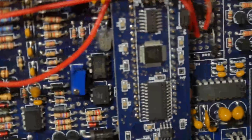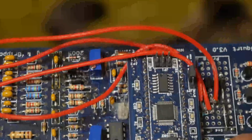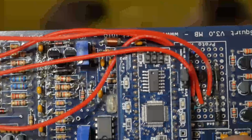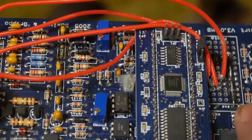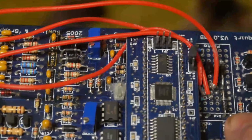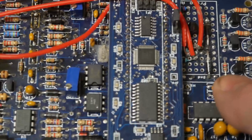All right, with the modifications complete, just one last thing. While we have a chance to view it, see those two blue boxes? Those are what you may hear me talking about later as we're trying to adjust the signal for the VR sensor. Those two are basically noise filters, and those screws in the top are what adjust how much filtering they're doing, so that we can get a clean signal from the VR source.